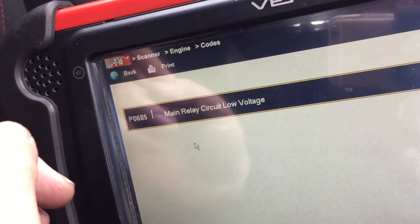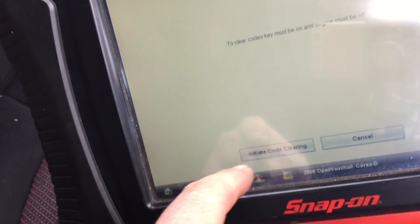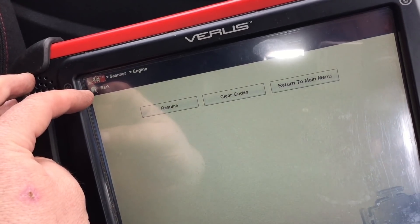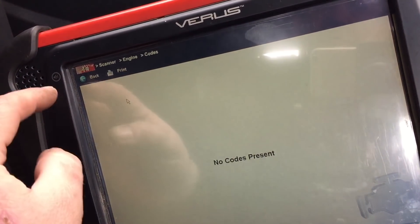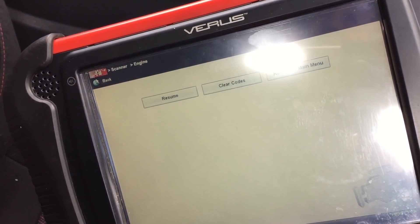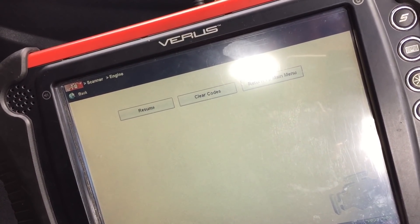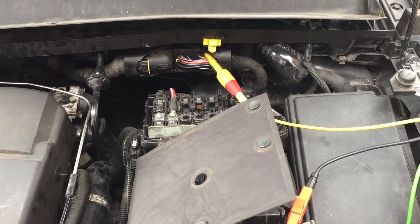It's intermittently going off, so it's directly related to that code. If you go back into our scanner, that's the code that comes up all the time. It doesn't actually tell you if it's present or not present on the scan tool, so we're going to clear codes. Clearing codes - that's complete. I'd be better to get the Opcom tool because it tells you if it's present or not present, unlike this scan tool. I'll connect to Opcom and see if it comes back.